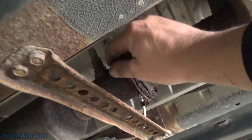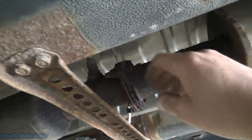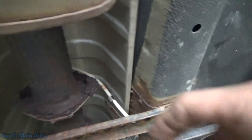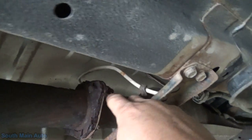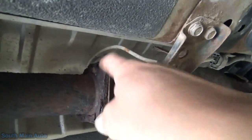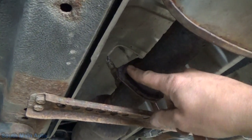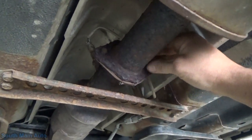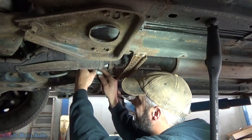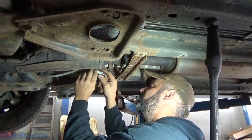I see it's got a couple of studs here - we could probably just take the torch, pull the nuts off them and hopefully save these studs. I didn't get any new nuts for it and I don't stock fine thread metrics, so that's probably what we'll do - take the torch, cut the nuts off, run some thread chasers over those. If it comes down to it we could always just blast these out with the torch and use nuts and bolts, but we'll try to preserve this flange as much as possible. First thing first, we'll get the O2 sensors unplugged.